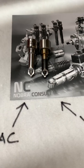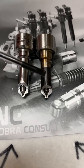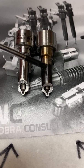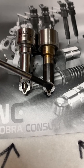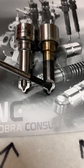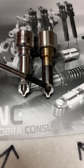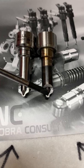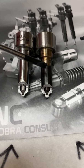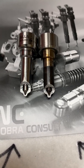We can see that this Delphi nozzle is a VCO kind of nozzle — it means it's made for cars and some trucks, more for the streets. It runs smooth, low emission, but there is a problem with the cooling. There is no space around the nozzle or around the needle for cooling, and the tip has very little space also. So this nozzle is not meant to run in boats that are constantly on high load with a lot of heat.